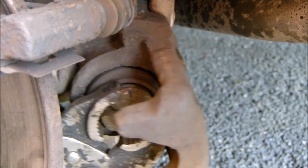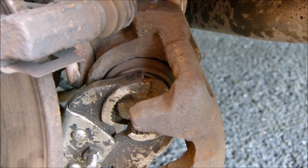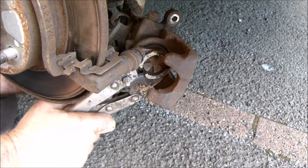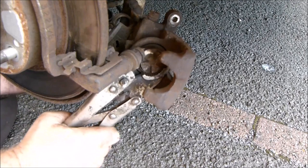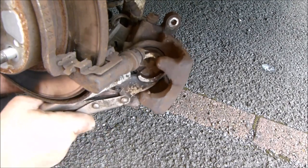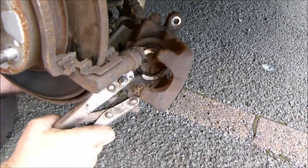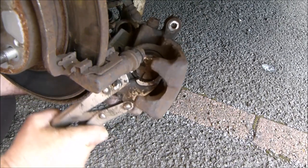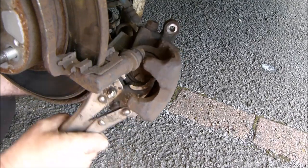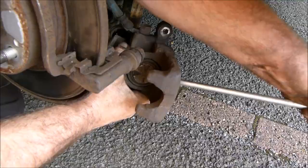Just carefully put it on the edge of the piston and hopefully, if your piston is not too seized up, it will start to turn. But be very careful of the dust rubber, because the inner piston could get wet and cause a sticky brake. You have to turn it in a clockwise direction and hopefully it will start screwing back in. To make sure the piston seats all the way back in, just use a screwdriver-type tool to persuade it the rest of the way.